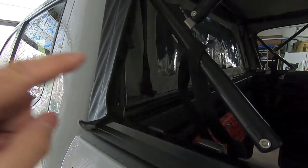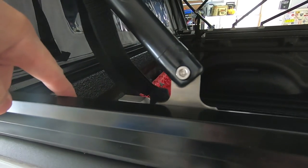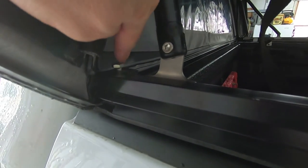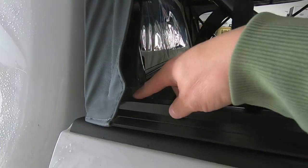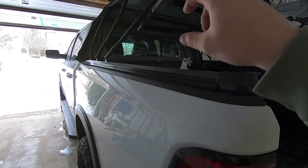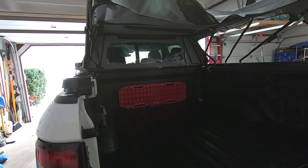This is probably the hardest part of the whole install, but it's very doable. I got the rail slid in and popped into the channel. I had to use a mallet on one side — I undid the front bracket on the side I was working on so I could pull it off and knock it in to seat it properly. Then there's a half-inch bolt right there that you tighten down to hold the bracket into place. Now we do the same thing on the rear — slide the channel onto the rear of the cover and pop it into the groove. Before doing the back rail, we velcro the front sleeve onto that rail so everything stays situated.